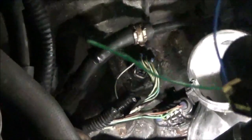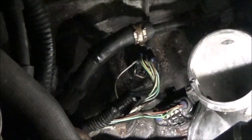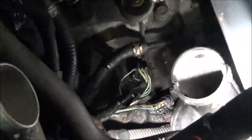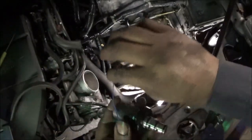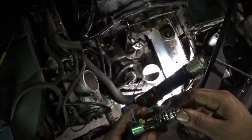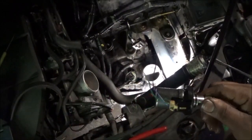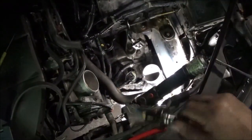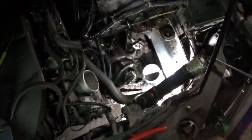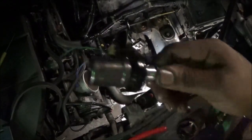And then I'm going to start the vehicle up and put it in reverse and see if it still throws a solenoid code. So this solenoid is going to be hanging on the outside. I already got the pan up. You already saw that. Now I got to put the fluid in. Again, this is going to be tied to this wire that I'm about to cut, and I'm going to have this part going to ground. We're going to see if that P0753 comes back up. If it does, with this solenoid on, there's something in this computer or in the wiring somewhere. Now this is just one way of trying to find out, but that means you would probably have to have a solenoid.